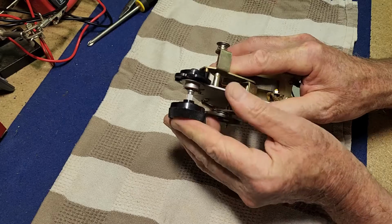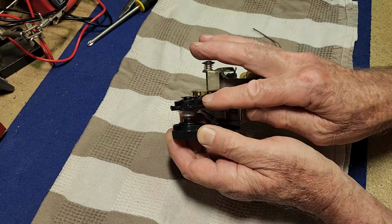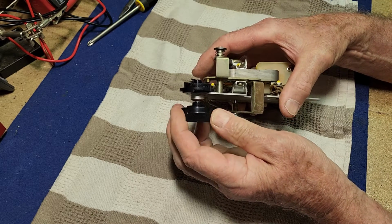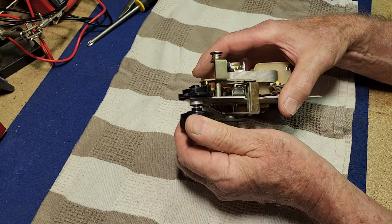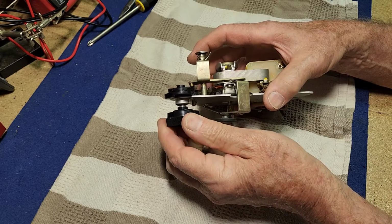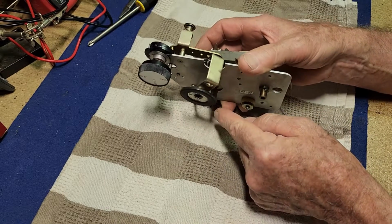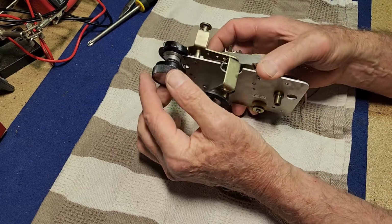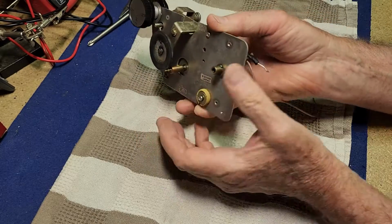Okay, so the knob for the off, 33 and 45 selector just has a ramp like a cam that pushes that movement in and out. Now, the spring here pushes it to its full travel, which is, okay, well now that's on the motor spindle. Why wasn't it on there before? Because it can't actually travel any further down than that. That's actually working perfectly now.